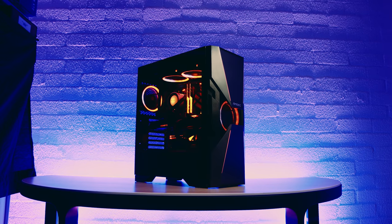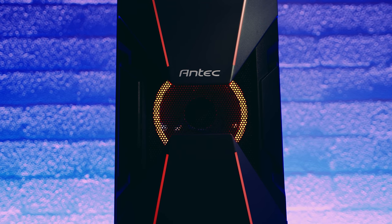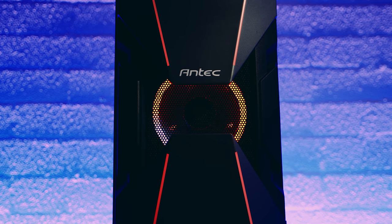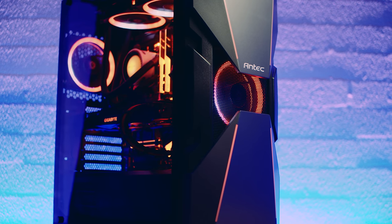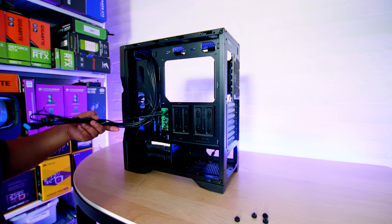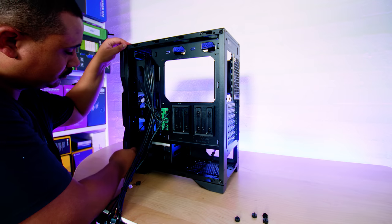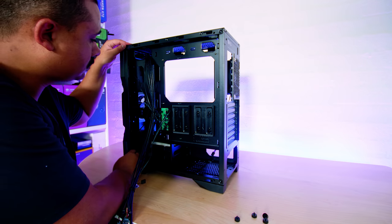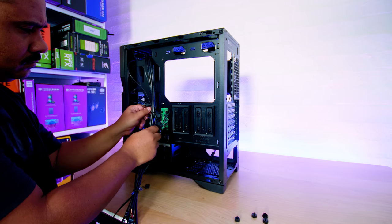Lastly, the case. It's the Antec Prime Dark Avenger DA601. This case is a little bit of a return to form for Antec, I'm not gonna lie. Despite what people might think, this build is not sponsored at all. They sent us review samples so we could build something to show you guys, and that's exactly what we did. The case itself is pretty well designed, but there are some oddities with it. I would like to have seen more cable tie downs on the back side of the motherboard tray, just to hide those cables a bit better. The included ARGB and PWM fan hub was giving me really strange issues with the lighting flickering, and when I changed out the SATA power connector, it seemed to have fixed it, which is really, really weird.